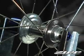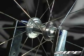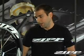What that does is it allows us to move the drive side spokes out by over 1mm to the right. Main reason we did that is the rear wheel is really constrained by space because that 9, 10, or 11 speed cassette takes up a lot of space on the right side of the wheel. That pushes the drive side spokes further to the center of the wheel. What we wanted to do is get those drive side spokes as far right as possible.